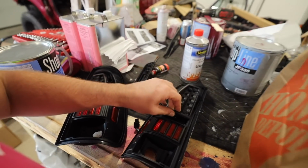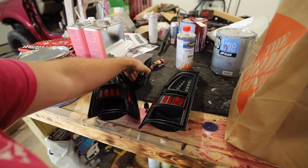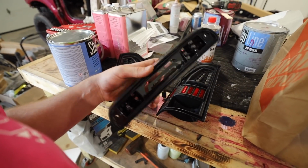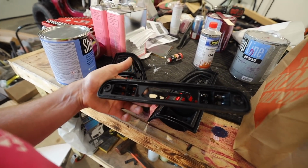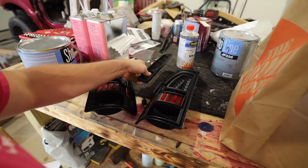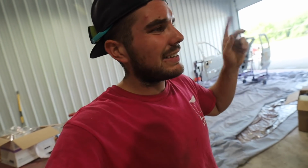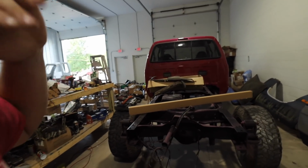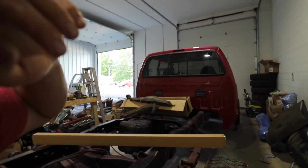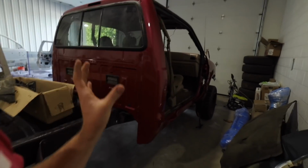Pretty much tape that box up, get these shot separately, and then here's the third brake light. It was just an eBay third brake light, 230 in the oven for like 4 minutes. We were able to get this thing pried out, and all good to go. So got a lot of painting to do, a lot of color match to do today, but like I said, this is the last handful of things. Headlights, taillights are getting painted, third brake light's getting painted, doors are getting painted, which means this whole truck from the cab up, really, including that third brake light, will be able to be reassembled here.